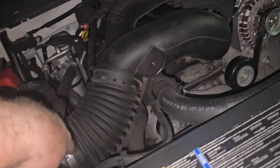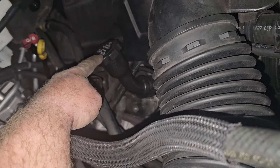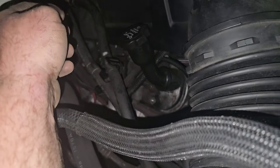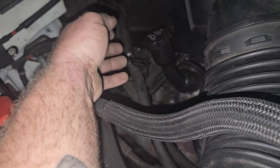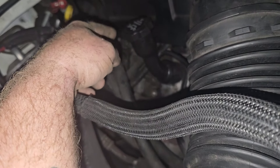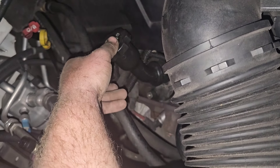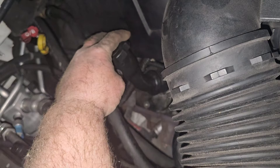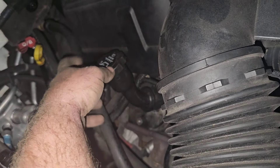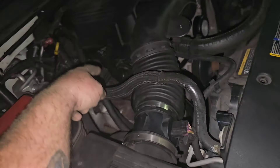I used the big bag, pumped it up, stuck it in this tube here, and I could see it was leaking around this fill neck. You can get this out by prying and slowly working it out — it does twist back and forth, but there's a lock down inside. Really the proper way is to pull the valve cover off and release the lock from the inside. I took a flat blade screwdriver and worked around the edge and pried it out without breaking anything. I had to remove this bracket because when you spin the neck it comes out with it — the bracket gets in the way. So I took the 10mm off that holds the bracket and put a new O-ring around it, which I'll link down in the comment section.